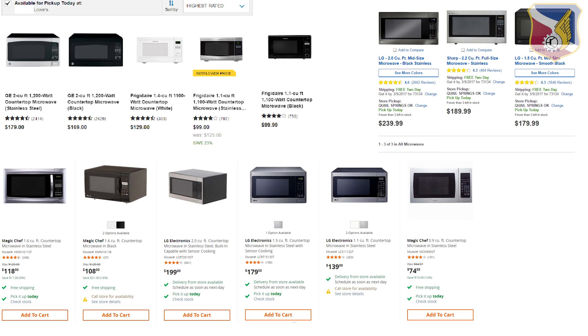After comparing all the different microwaves at department stores — taking average decibels from the center and all the corners — I found that some brand new microwaves had pretty bad leakage, around negative 50 to negative 40 dB, a totally strong signal. A lot of them were around negative 70 to negative 60 dB. The microwave I picked in the end was an LG microwave, which had almost negative 82 decibels. I brought it home, used the microwave leak detector, and it measured 0.9 milliwatts per centimeter squared. We're pretty happy with the purchase, and hopefully this technique will help you out with your next microwave.